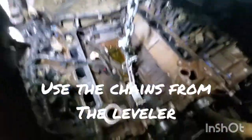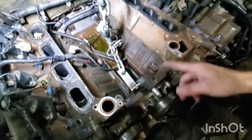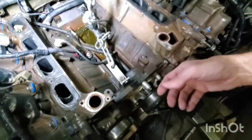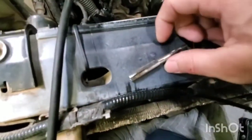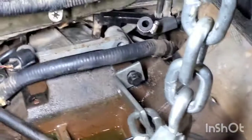I come back here after taking the intake off — the alternator sits right here in the crossover pipe. You'll see three holes in the block. I clean those with a 10 by 1.5 thread tap, clean those up, and then I also run a bolt on the rear side there.